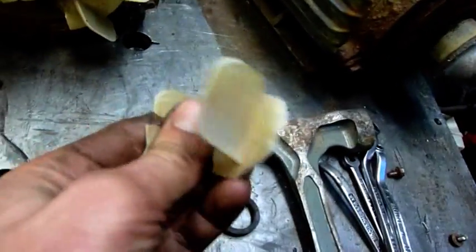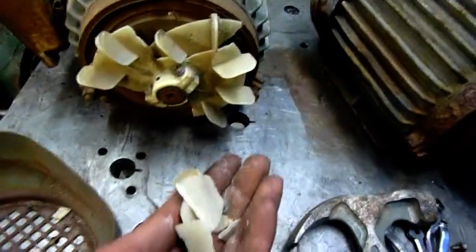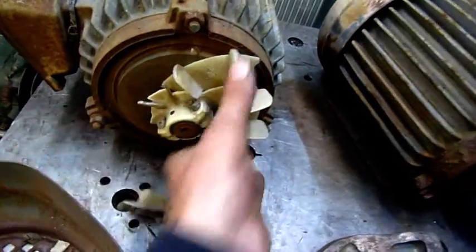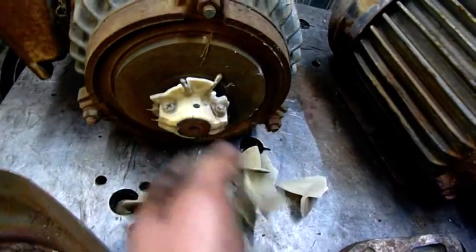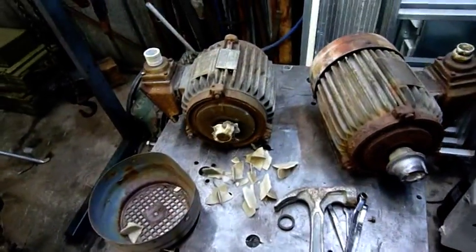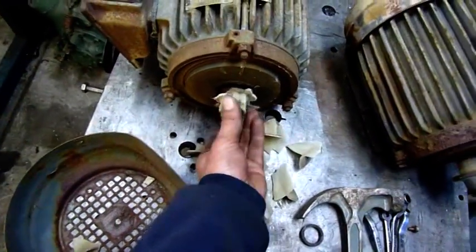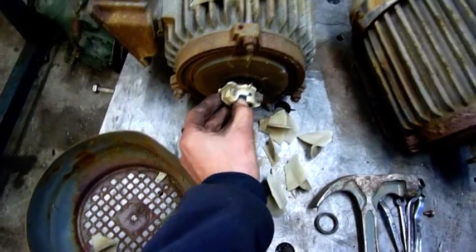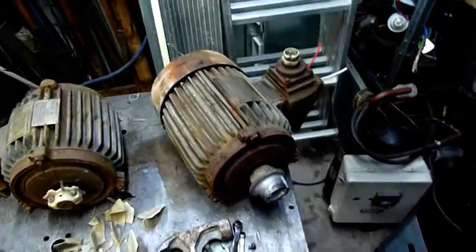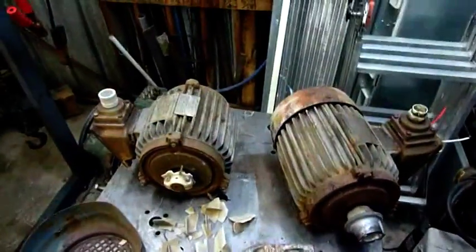That's a shame — it's all fallen apart. It's made out of glass-filled nylon so naturally it breaks down after a while. I'll have to find a motor at the scrap yard that has a similar size and just adapt it. Looks like it's got a rubber bushing on it anyway — I'll find a way to fix that. That's the least of my worries; the cowling can go on afterwards. The main thing is I get the rest of the motor together and new bearings in it.